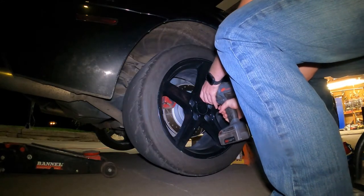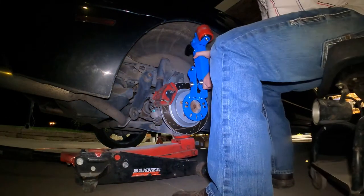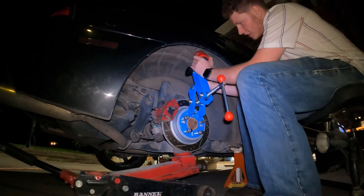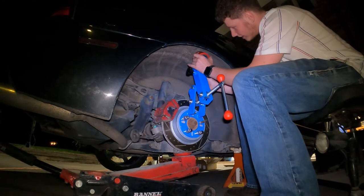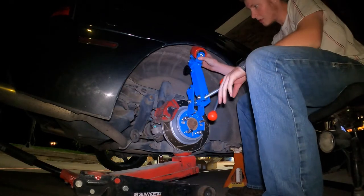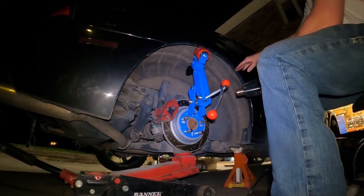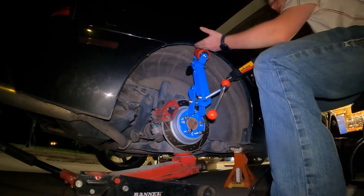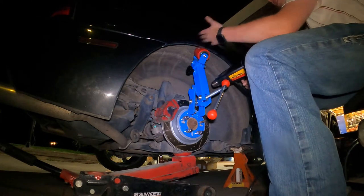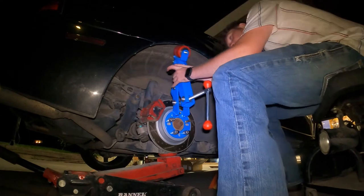Start by taking the wheel off. I'm gonna jack this up and then put the fender roller on. Now that we got it all ready to go, we'll adjust the angle first — we want a light angle so it won't crack the paint going too aggressive at first. Now we'll get it a little bit tight and set it right there. After we got it all set up, I'm gonna start heating up the metal, from where the bumper starts right here to the other side. I'll start rolling gradually and keep it hot so the metal will move easier and the paint won't chip as much.